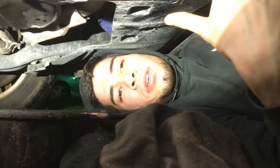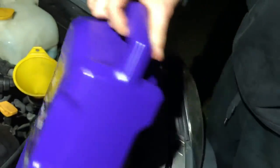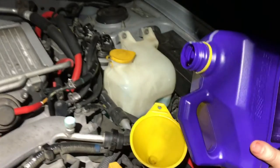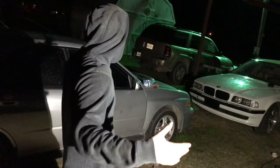It's barely dripping now so the new oil filter is good to go. We're fixing to put the new oil in — we're gonna use about four quarts. There it is — one, two, three, and four quarts. There you have it. I just changed the Subi's oil and the filter, so hopefully you guys now know how to do your own car. If you have a Subaru, it should be the same. Don't forget to like and subscribe — catch you guys on the next video.